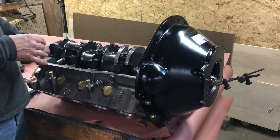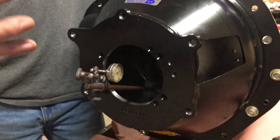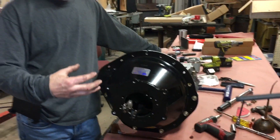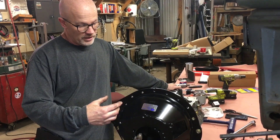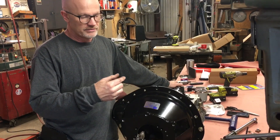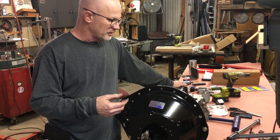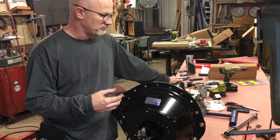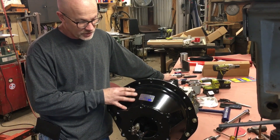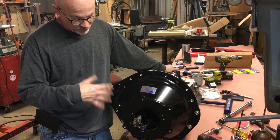What we're doing when indicating a bell housing is making sure that the opening in the bell housing is as centered to the centerline of the engine as possible. If it's not, when you put the transmission in, the input shaft is actually going to be going around egg-shaped. At 9,000 RPM that does destructive things — it'll wear out pilot bushings, bend stuff, break stuff. So any time you change a bell housing you want to check it. This one was actually off and we've already got it dialed in.